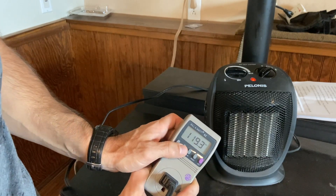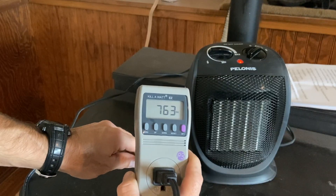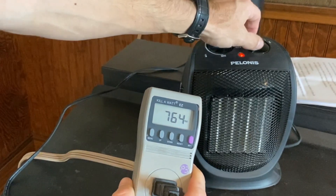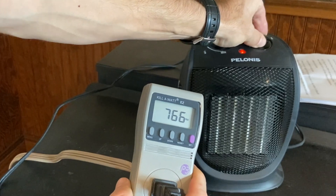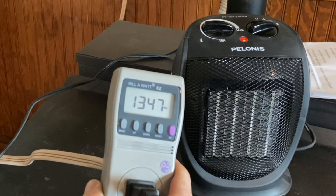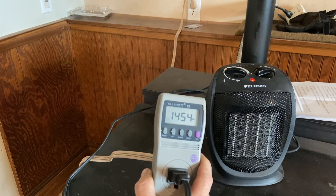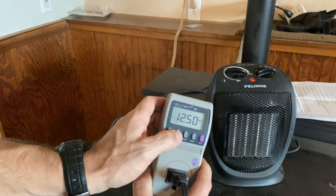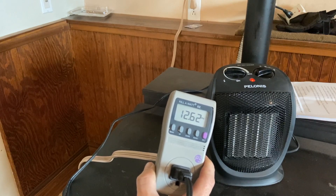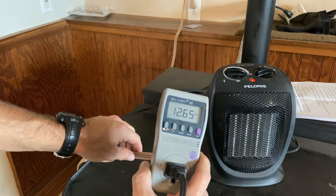Now let's see how many watts. There it is — 762 to 763 watts. Now I'll go up to high. Now it's 1,400 watts. Look at the amps on this now — it's 12, pretty close to 15. So I don't think I would recommend leaving that plugged into the meter for a week or something. I mean, it says you can, but...